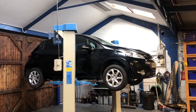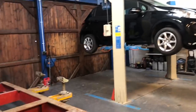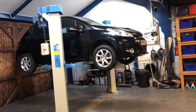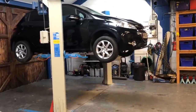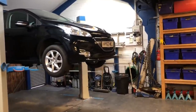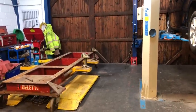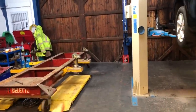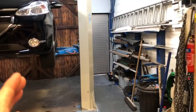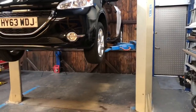Hi everyone, welcome back to the channel. New video on the Peugeot 208 — today is the day we're going to get it on the frame machine and try to do a repair on that sill. Quite a few of you in Wednesday's video comments said surely you don't have to put it on the frame machine, but we do actually have to because that's the idea of it — we use the framework to push off of, mounted on those sill clamps, kept very tight. Now we've got it up on the ramp I can show a bit more of the damage on that sill and why we needed to put it on the frame machine.